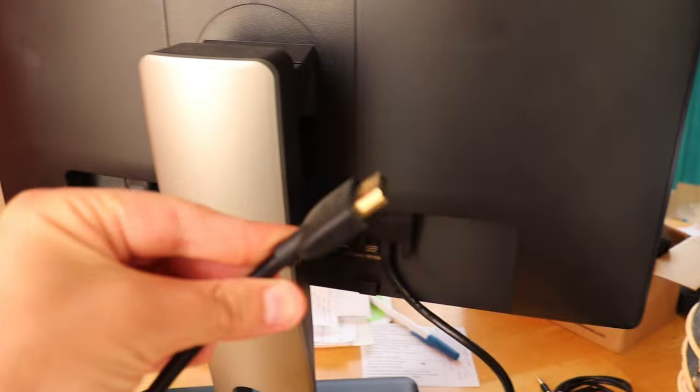So if you're hooking up your laptop to your projector and it's just VGA, then you are gonna have picture but you're gonna have no audio. So if you are using a VGA cable, or that's all you've got, an HDMI cable is probably gonna be a better option. But say you're using a device that doesn't have HDMI on it, like maybe an older laptop or something like that.